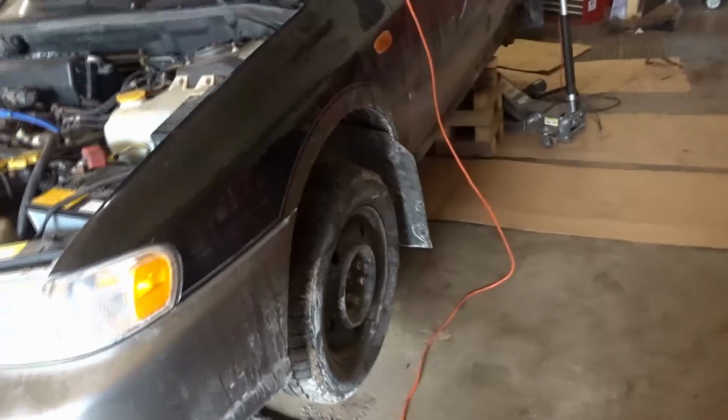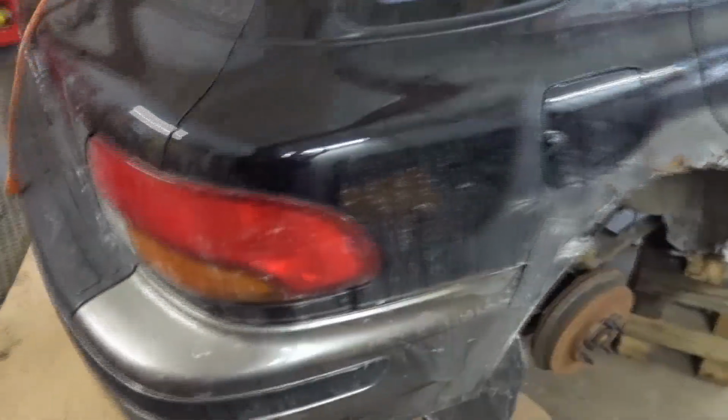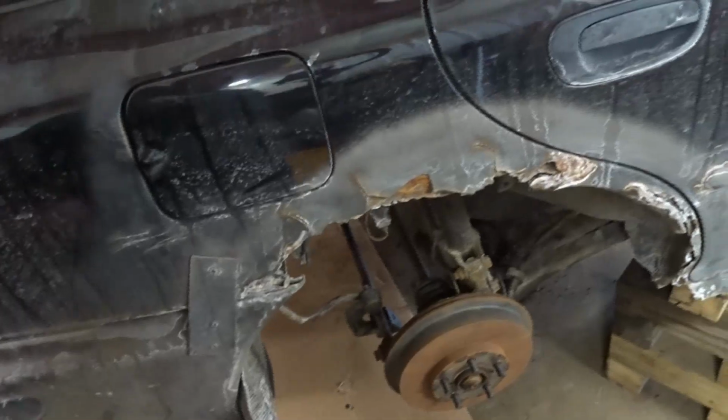The rear diff is in. I cleaned it up, checked the cover, you saw that. I drained the oil. I threw in what little bit of gear oil we had. Now usually it takes a little less than a liter to come out of the fill hole, and usually they say the easiest way to do it is just go until it's about coming out of that and seal it up. Well, did that. Put the axles in, all that's good to go.